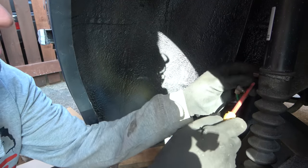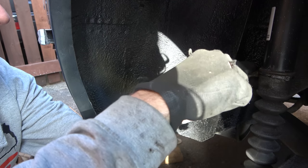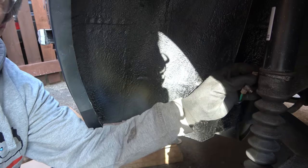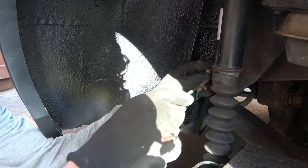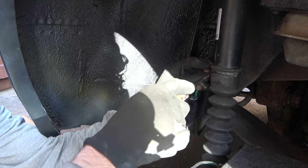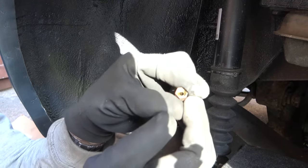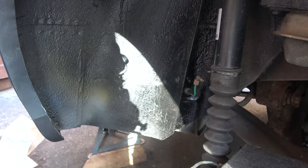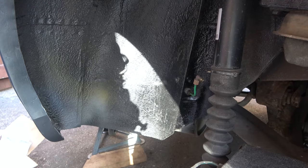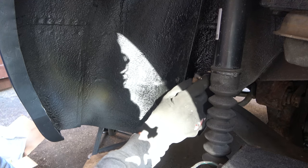No nothing at all. How does this come off? Oh, it has a little olive type thing - this tiny little olive. So the olive must crush onto whatever's in there. That's going to be a bit of a pain - if it's leaking from there I have to change that olive. Looks like there's an olive in there. I'm going to gently lever it with a screwdriver - I don't want to break the whole strut. Being very gentle, just twisting the screwdriver. There we go - excellent! I took it off including the olive. I'll keep all these bits - they cost just under 20 quid.